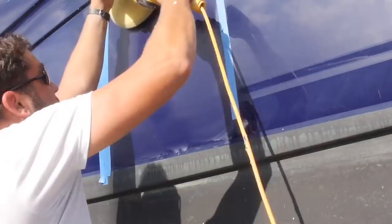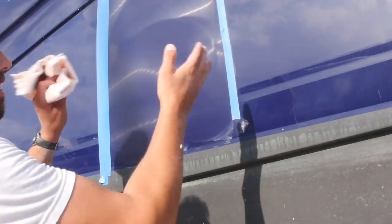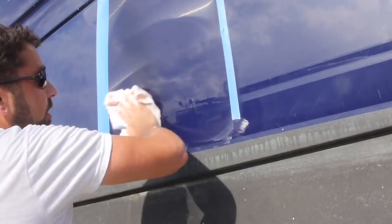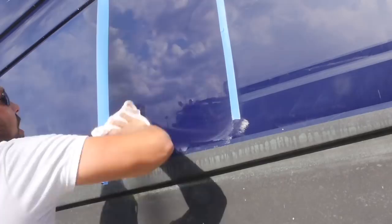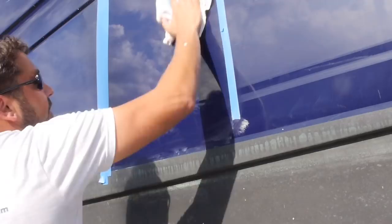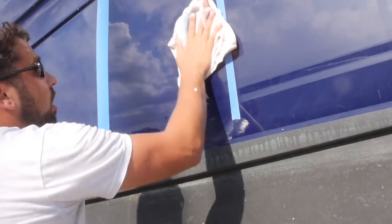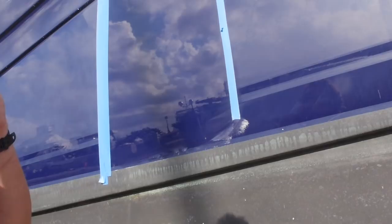I kind of constrain myself to a very tight test spot. You'll see me doing a lot of back and forth — we call that the typewriter. Usually you want to mix up your stroke as much as possible: go back and forth, up and down, on an angle, a little half moon. Not seeing a huge difference here — still have about the same luster. Maybe my face is a little more handsome with this clearer reflection. But I'm pretty happy with that number 2 step. I'm going to go ahead and switch to number 3.